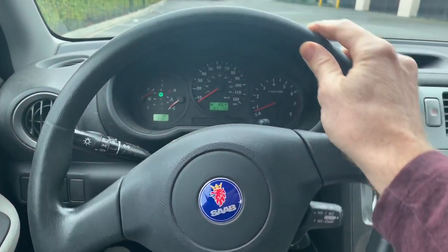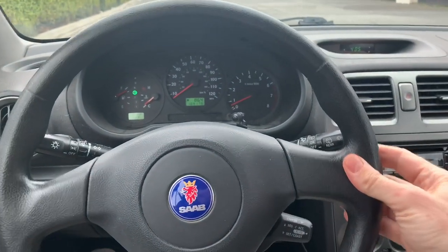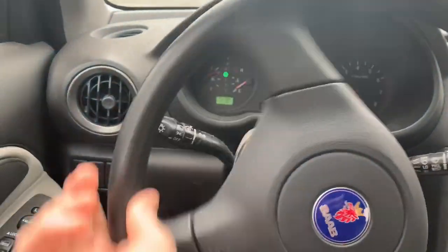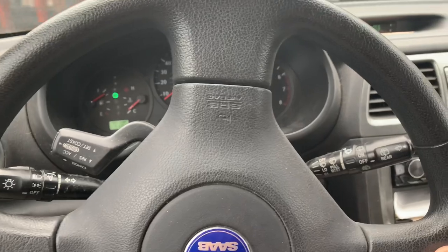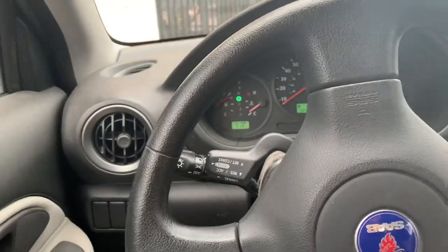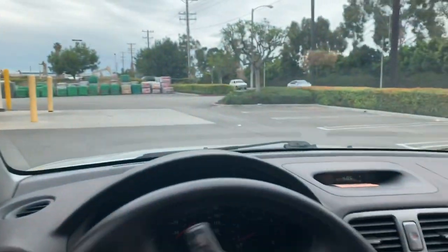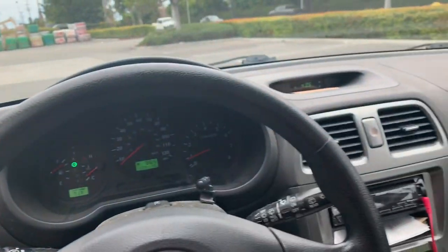This closed course just happens to look like the Home Depot parking lot. So if you're driving straight ahead and there's not much noise — I get a little vibration in the wheel, but I don't get much noise. But then if I turn it, you hear that rumble and feel that rumble. That's the U-joints trying not to break in half. So when you're driving straight ahead it's fairly quiet, but while you're in the process of turning you hear that grindage — then you most likely need new axles.